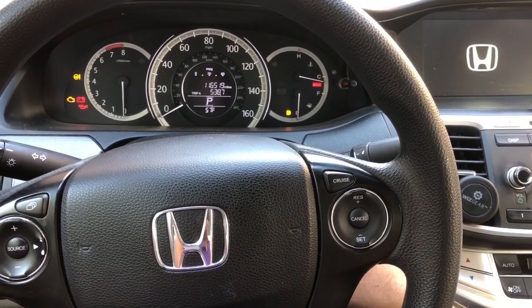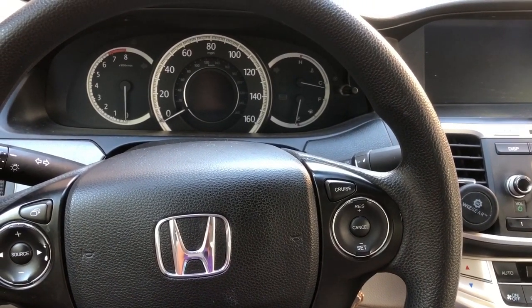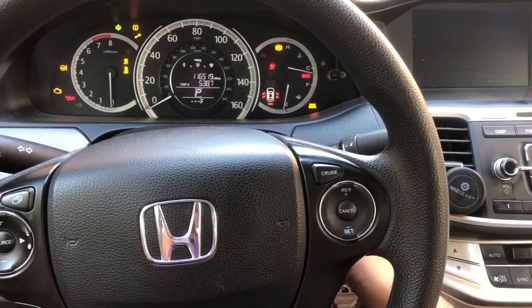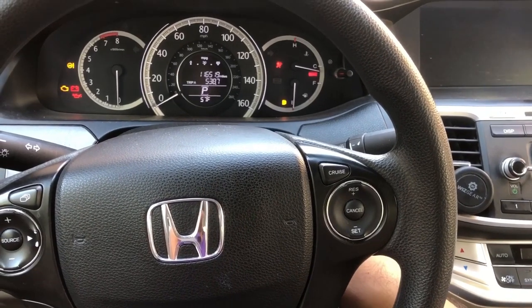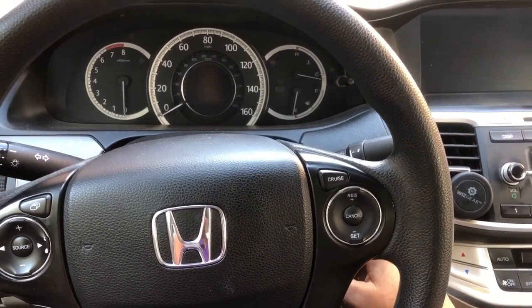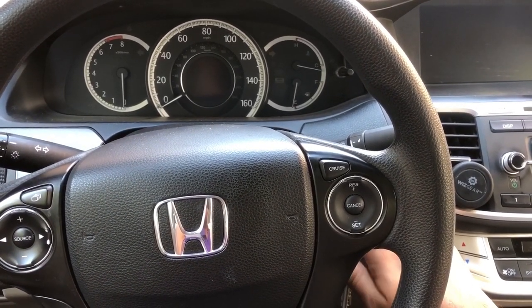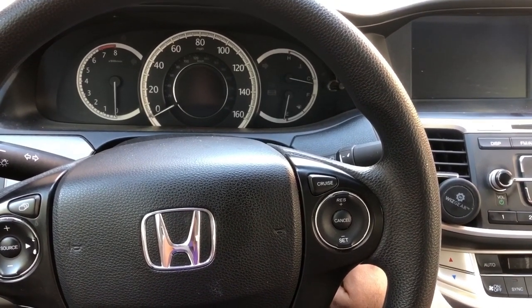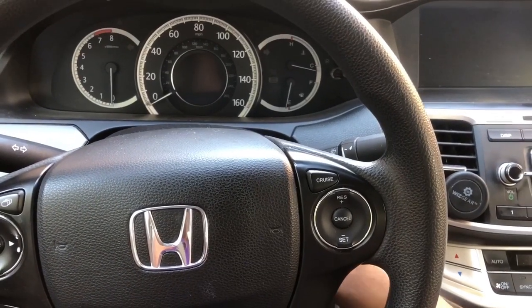Like that, it just goes away. Turn the key back to off. Wait a couple seconds. Repeat the process. Usually about the second or third try, it will crank. Which means the starter is going out and needs to be replaced. No starter motor.